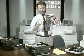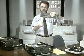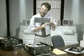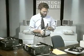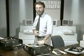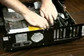In my experience, it doesn't matter much. However, what does matter is how you handle the board. You can handle a board like this, you can handle a board like this, you can handle a board like this, but don't handle it like this. Keep your fingers away from the gold edge connectors on the board. You don't even see it, but your fingers have a layer of gunk on them that can impede a board's working properly. And by the way, it doesn't matter which of these expansion slots you put the board back in. In 99% of the cases, there's no difference between one slot and another.